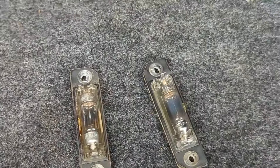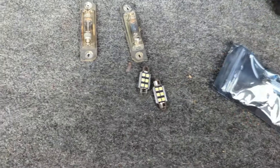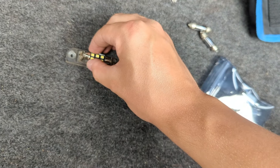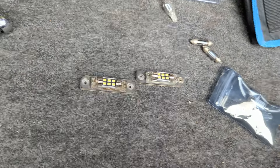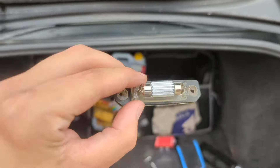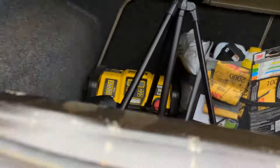Here are the old lamps versus the new LEDs. I'm going to be quick because it's starting to sprinkle. You just pull them straight out and pop the new ones in place. The LEDs are in the housings — I did have to pull on the tabs a little to seat them. One quick correction I realized: the light-outputting part of the bulb needs to actually face the lens — the heat sink goes on the outside. Now let's get them installed and see how they look.